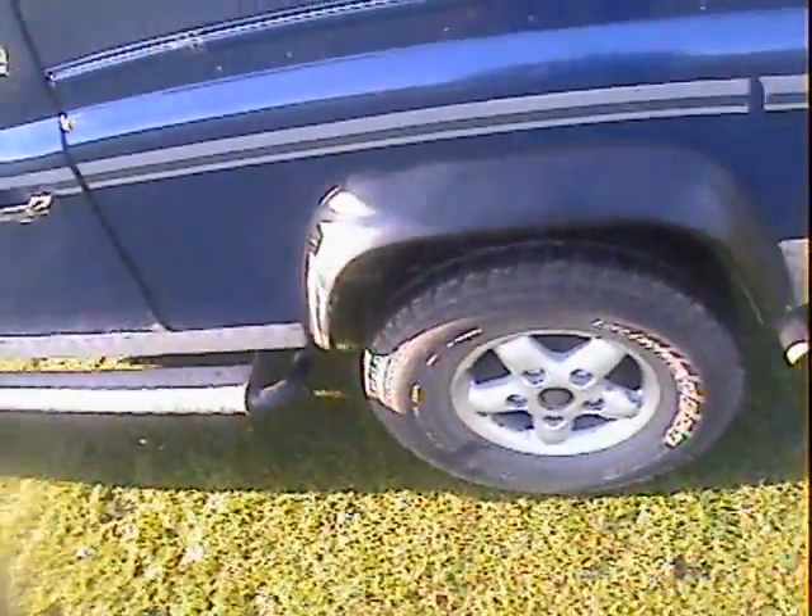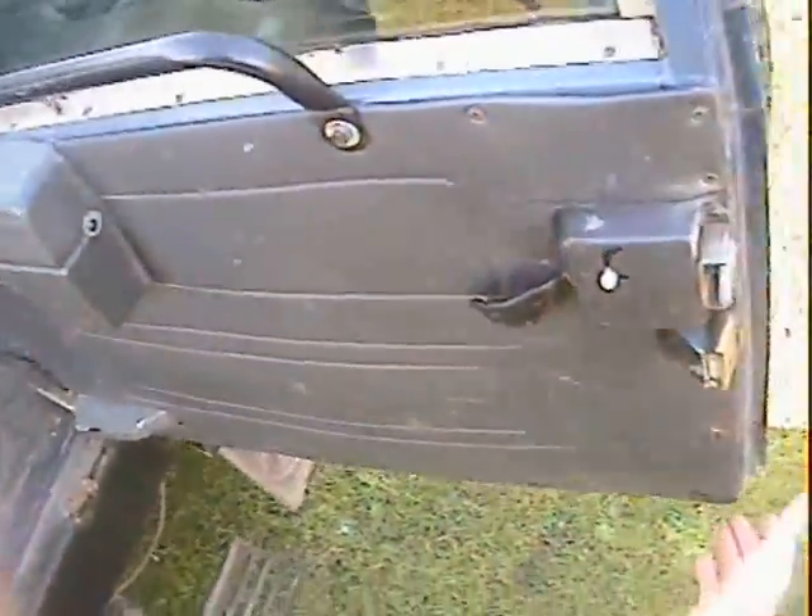There's a bit of paint loss on the roof just up there. The nearside van side looks good apart from a few hedge scratches, and there's some bubbling coming up on the tub top trim at the joints. Around the tail end the cross member all looks good from the outside. There's the usual electrolytic reaction around here. In the back there's a bench seat with seat belts on this side, and the back bench seat back on the other side with belts but not the base — another base and cushion can probably be sourced if needed. The tailgate is good, the tailgate bottom frame is very good — just a bit of surface rust but no more than that.